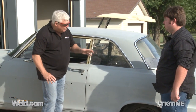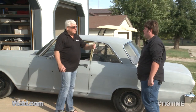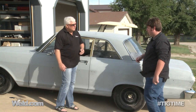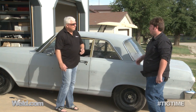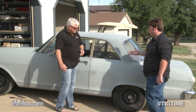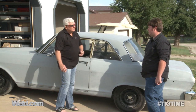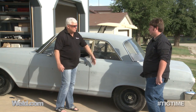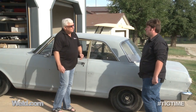Let me ask you — why would you have these filled up with weld as opposed to just putting bondo in? Well, the bondo — actually somebody had bondoed in the holes before — and it just cracks out. It won't stay if you don't have something behind it. It ends up being just a nicer product when it's welded properly. You don't want to put a $5,000 paint job on here only to have the holes crack out — I could just push the bondo right through the back of the hole and have a car with holes in it again.